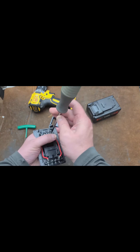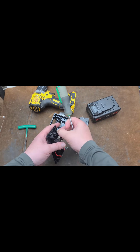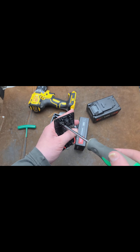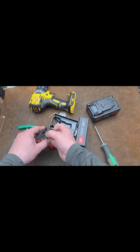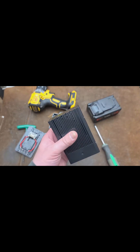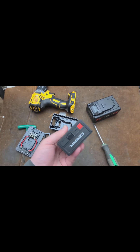There was one video of somebody showing on a Makita saw, running it until it overloads. With a normal power tool battery, you release the trigger, wait a second, it self-resets, and then you just go back to work again. But with this thing, once it has an overload due to excessive output — working it too hard — once it shuts down, you actually have to plug it into the charger to get the battery reset.